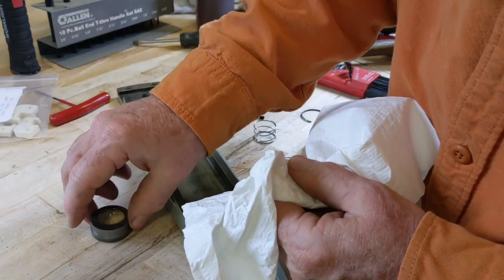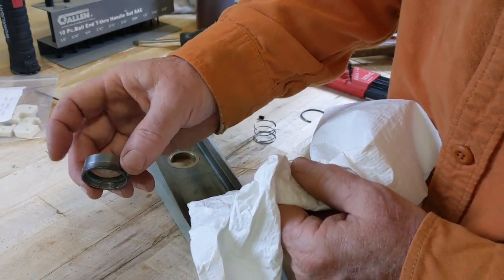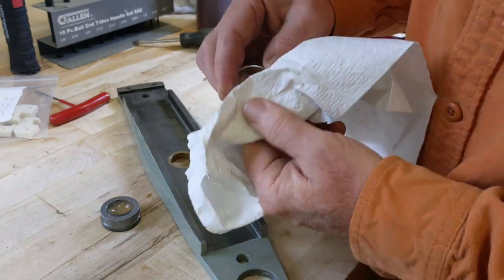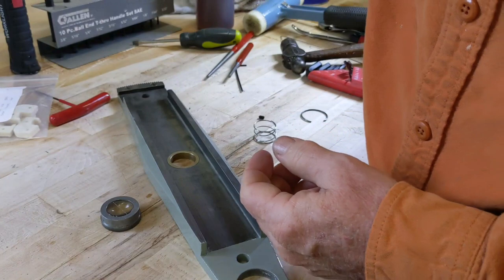Be very careful when you work with this part — don't use brake cleaner, carburetor cleaner, or any solvent-based cleaner. Also watch out with purple cleaner on aluminum — that cleaner does react with aluminum and can make a mess of it if you let it sit too long.